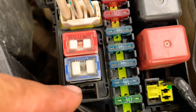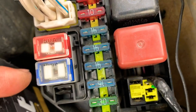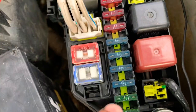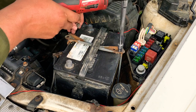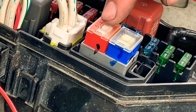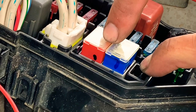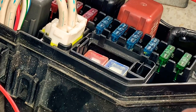The purpose of this video is how to replace the main fuses on this Toyota Tercel. Most of us think they can be pulled out and we try and try, but they're bolted down and that plastic piece will not come out. To get the fuses out, you pull this little black plastic tab towards the front, then push down on the fuses — they go like an elevator, down and out through the bottom of the fuse box.